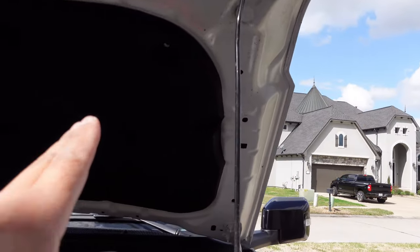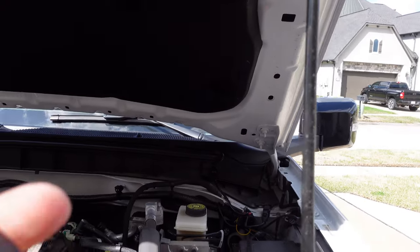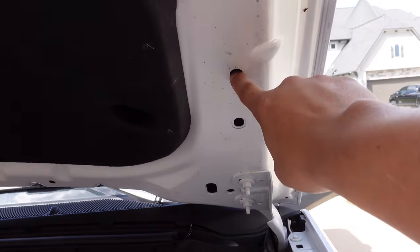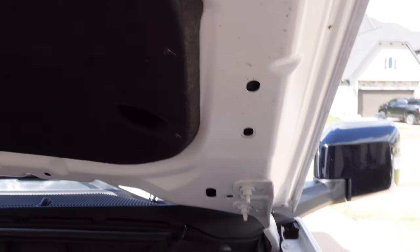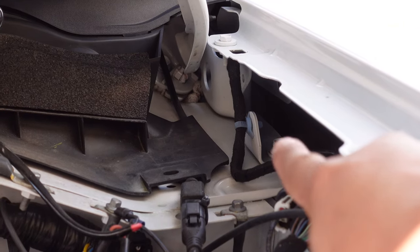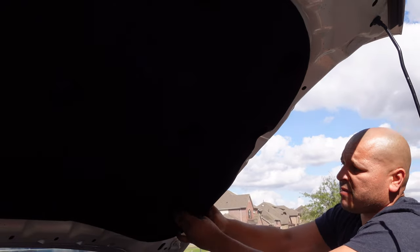For the install, we need to lift the hood — not remove it all the way, just get access behind it. Over here it's really simple; just pull on it and you'll pop off these little clips, that's all that's holding it. We need to access the back of the hood to mount the top bracket at the hood hole. There's a little access hole back there, and then we'll access the lower hinge bolt using a 13 millimeter socket. Let's start by removing the insulator clips.